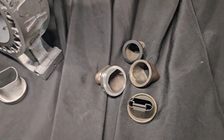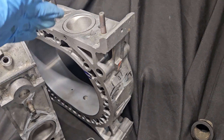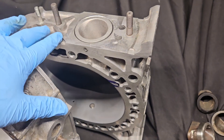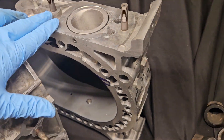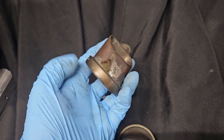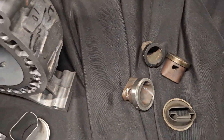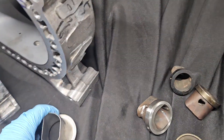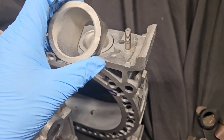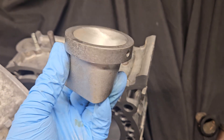These had very specific intended goals from Mazda. When it comes to performance — when you're playing with rotor housings, you're doing porting, you're trying to make power — the straight-through design is the best. Obviously you don't want to block your exhaust flow. But even the best sleeves often had EGR ports or passages, and I've talked about those in the past.